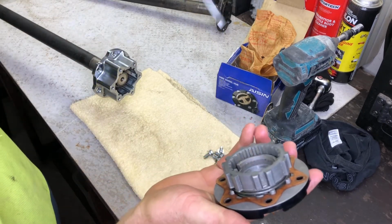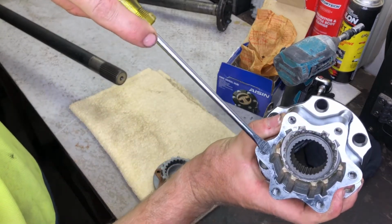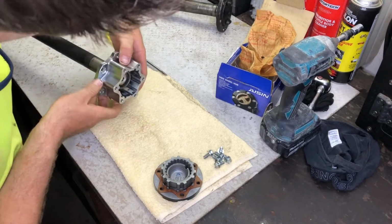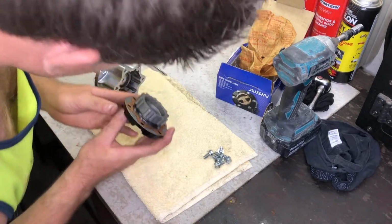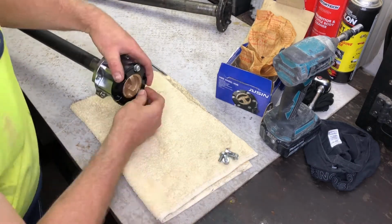The smaller tabs on the outside of the pawl now dictate how the freewheel hub assembly is installed into the hub body. The larger internal openings will accept the splines on either side of the tabs. Next, I secure the hub cover into the hub body and check that it functions correctly.